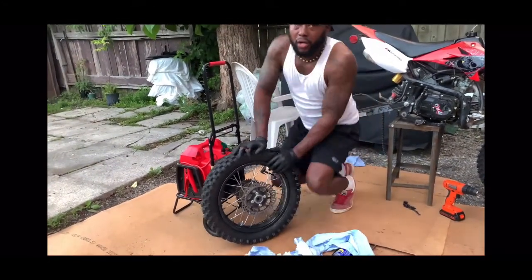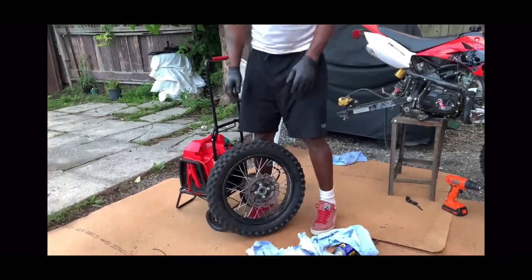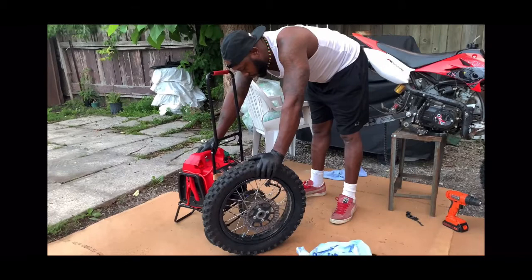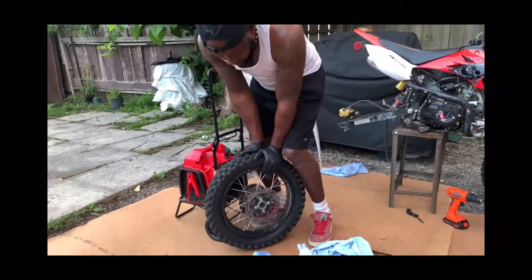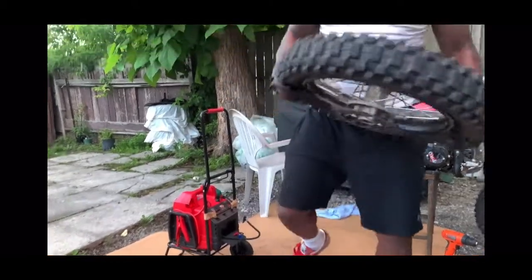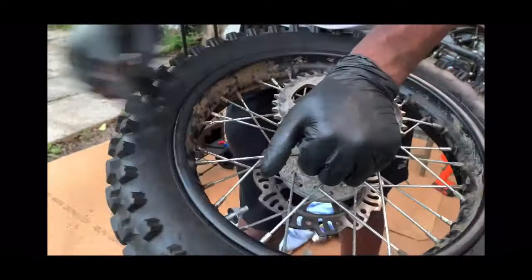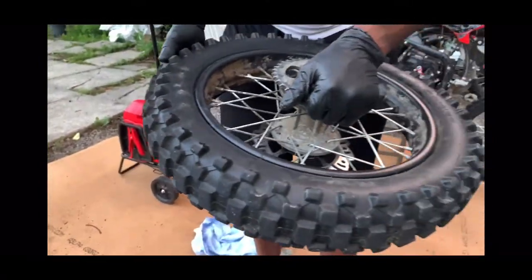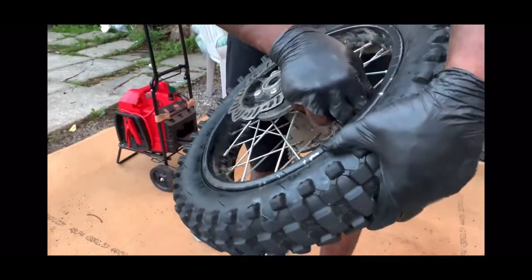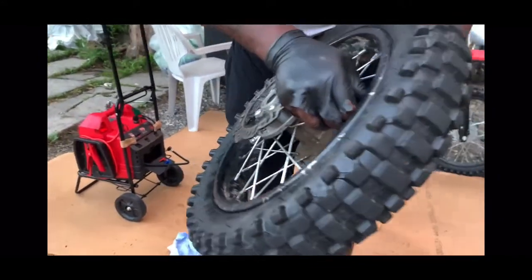When you have a rim lock inside your tire, you don't have to put a lot of air to make it really tough. If you have less air, it's more traction and a more comfortable ride. So let's put a little bit more air inside. Look around — the rim lock is sitting right here. I did a good job putting this rim lock in. This is my first time — I did some research online. The rim lock is seated straight, the valve stem is seated perfectly, and I'm so happy. I don't have to worry about my tube being popped anymore.